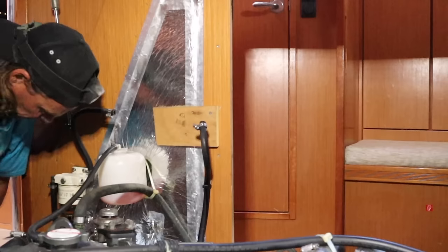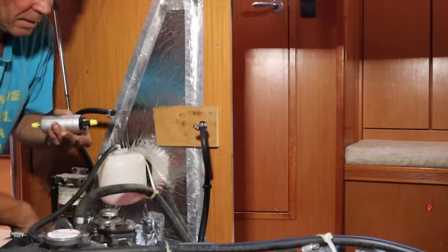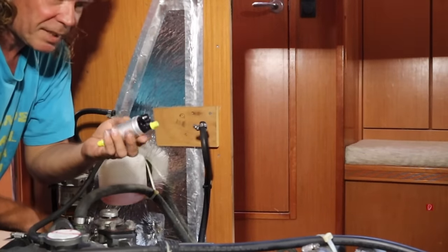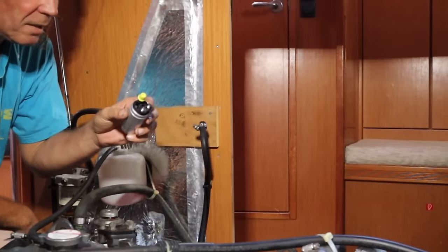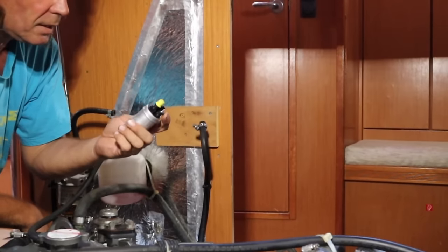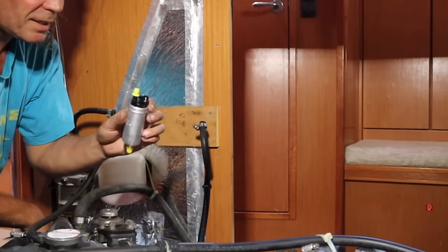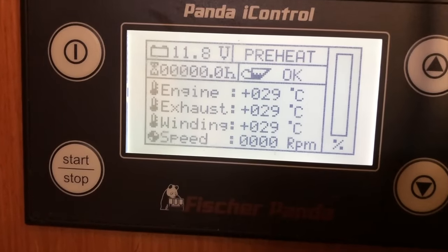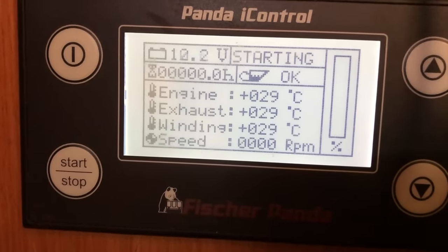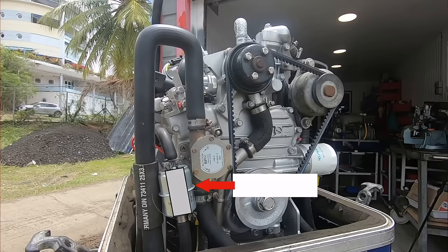After changing filters or the feeding pump, jump-wiring the feeding pump will save you time as well. You only need a cable from the positive on your battery to the positive terminal on the pump. Then you will hear the fan start and also the feeding pump sending diesel through the line. You save your battery and time because you are bypassing the unnecessary preheat and start procedure. And with a glass filter you can see when it's time to try starting.